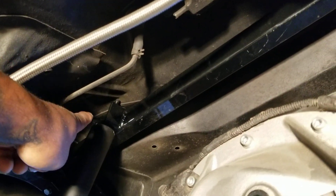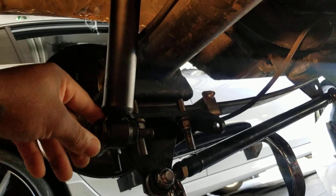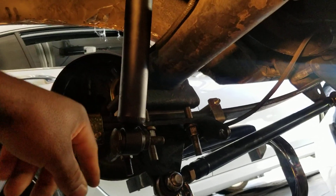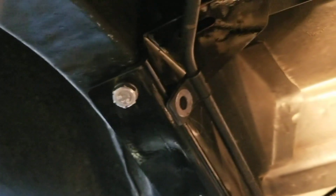There's another location for the shock and it goes down to the cal tracks. They give you brackets — I don't know why they gave me four — but they give you brackets if you don't have cal tracks. Same thing on this side: all of this is gonna get welded up, plus grade 8 bolts.